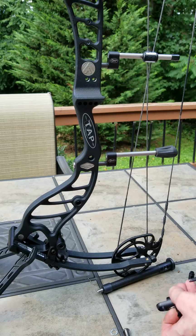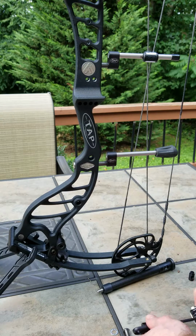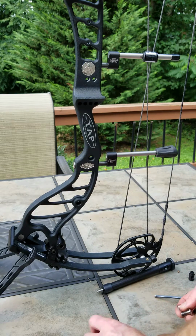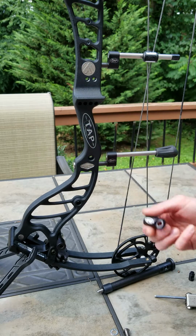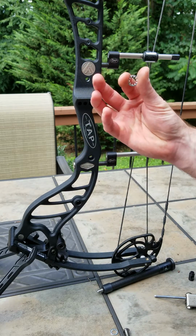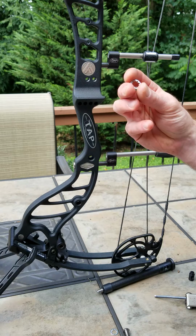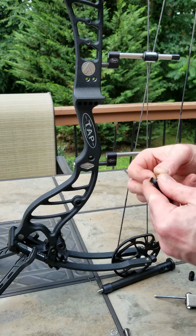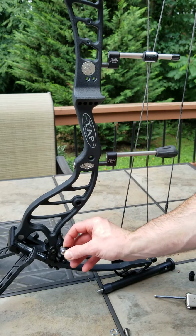Next step would be that you would add the section right here. It's got the smaller circular diameter to it. This is the part that has the etched in logo. You want to put your screw through the top, and included with these mounts are inner tooth lock washers. They're 5/16 inner diameter. Outer diameter is about 0.595. You want to make sure that those are on here against the surface of the aluminum, and that they are then mounted in against the other surface.